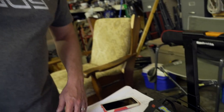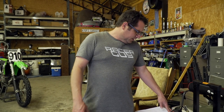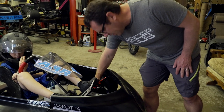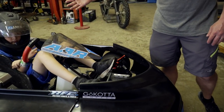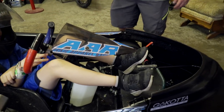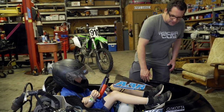That's just kind of how you get your percentages. If you're new to racing — most people know all this kind of stuff — but that's just the way you go about doing it. It's pretty easy math. Adding weight to this: there's no suspension on these, so a lot of times you can add weight and it's not going to change your cross. But on this one, it did change the cross. We went from 63% cross, which is about on the low end of what we want, down to 61.8%. So we lost over 1% of cross weight — that's a pretty big adjustment. We're not going to add more lead; we're going to move washers on the spindles and change the frame height to get that back.